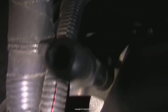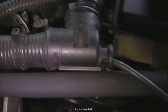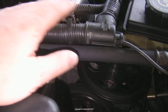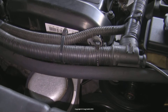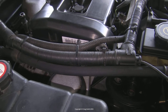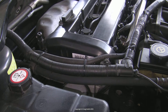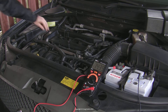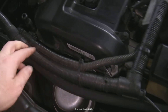I mentioned battery connections before in the other videos — checking for corrosion or loose fittings at the battery. I once destroyed an alternator on this car because the positive wiring cable from the alternator, which runs along here on the side of the engine, came loose and ended up rubbing against the power steering pulley. It eventually wore through the insulation and shorted the alternator positive to the engine body, overloading and cooking the alternator completely. You can wiggle any suspect wires while watching voltage with the car running — any weird changes while you wiggle a cable means you should suspect that particular cable.